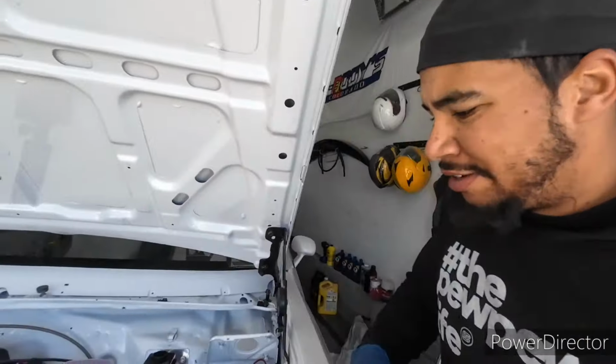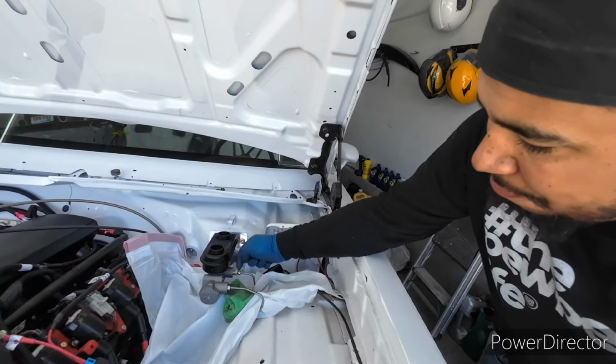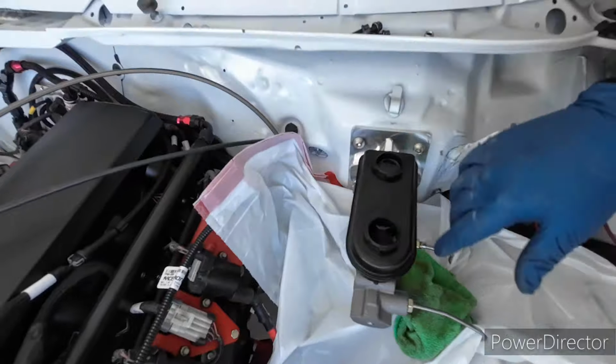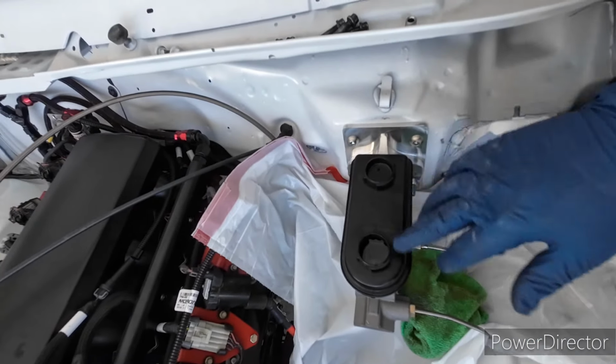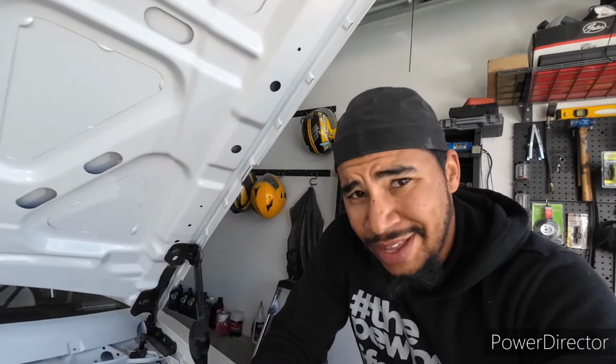I think I knocked the brakes out. I did the new lines, nothing's leaking, and I pumped the brake a few times to see if the fluid was going down, and it is going down on the front and rear. I checked the bottom where the proportioning valve is. It's dry down there, so I think we're good.